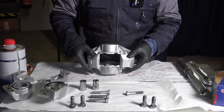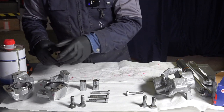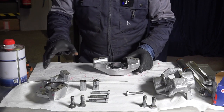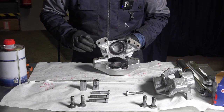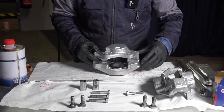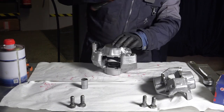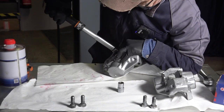Here's the first one that I pre-assembled already, and now we're going to assemble the second one. Make sure the seal is inside between the two calipers and that the surfaces are very smooth and not damaged — otherwise you'll have a leak. It's nice and tight, everything is in place. Now we make sure this lines up with the hole, put a small bolt here, then two bigger ones, and pull them to the right torque.